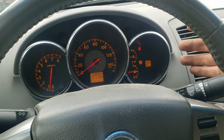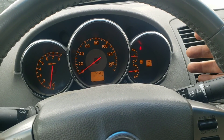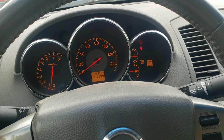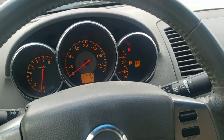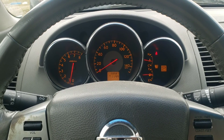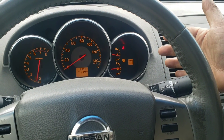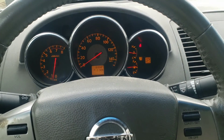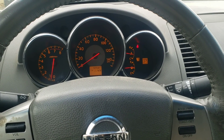It might come back eventually on its own after driving it around enough. The most important thing is, while you're driving it around after you do this — first few drives — keep an eye on that temp gauge. Make sure it doesn't overheat, because if you get a big enough air bubble in the system, it will overheat. Anyway, that's how you do it. This is like burning my hand now, so I'm 100% good to go. It may be easier for you, it may be harder — I've had to do this for like two hours before, but I'm only about 10 minutes in here. If this video helps you out, make sure you like it. If you want to see the other stuff I've done to the car, check out the Altima playlist. Subscribe if you want. Thanks for watching — I'll catch you on the next one.